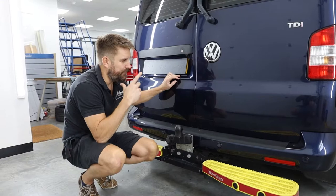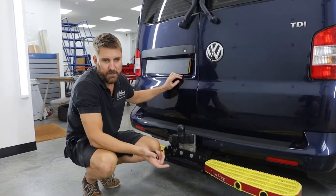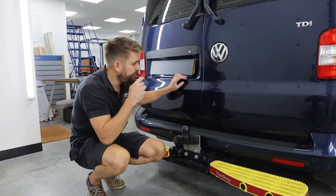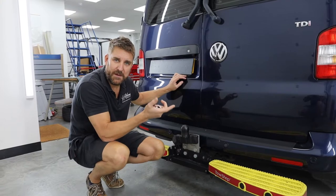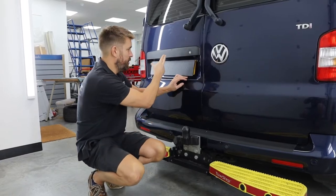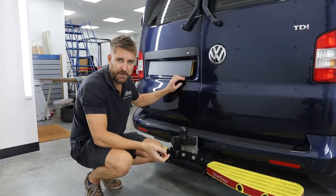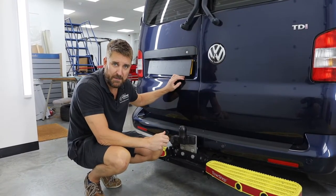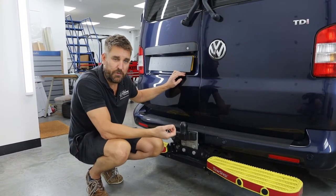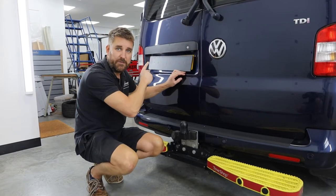So as I mentioned, this is a barn door — not everybody knows what that means. They're standard doors that open out, like a barn. The other option on a transporter is the tailgate, which is the up-and-over door. This is a little more difficult. If you had a factory fitted camera from Volkswagen, they'd fit it right in the middle of the grab bar, which means you're already off centre. So with these grab bars, we take apart the left-hand side door, take all the lock mechanism out, remove the grab bar, and fit one of our matte black cameras using a hole saw. We seal it with hot glue and run the cabling back through the door.